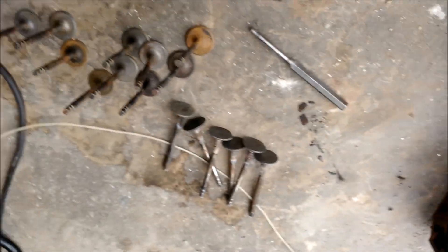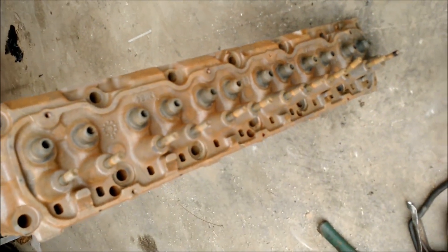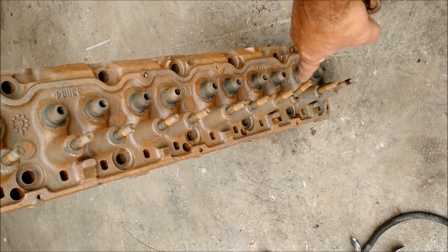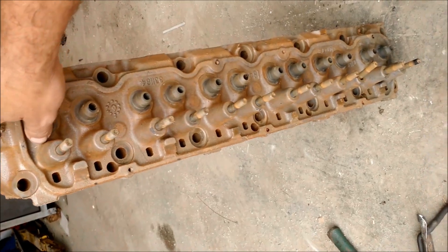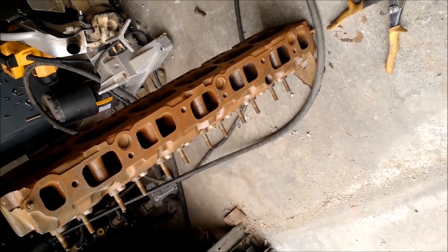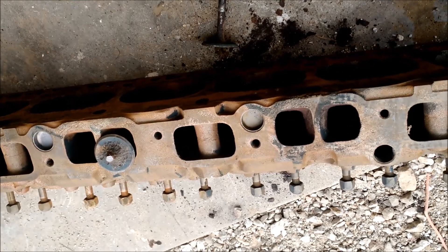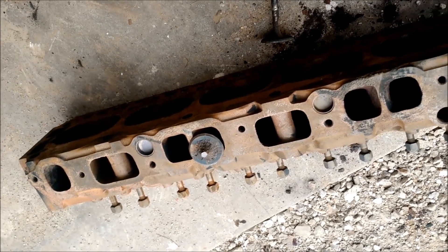Just to show you that molasses works — these are a bunch of valves, and all these valves were stuck in heads. Here's one of the heads that was rusty. This is a guinea pig head — it's got a broken rocker stud, the boss is broke off completely, so this head is going to be used in the CNC machine as test fodder. The flash rust on the other heads will be taken care of — these go through the shot blaster next, get cleaned up, then we pressure check them, mag them, and they'll be ready to go out.